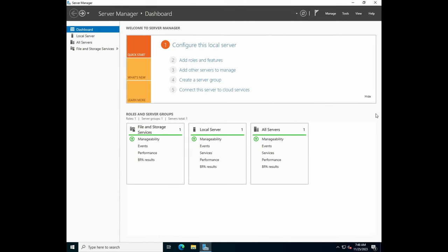The update finished. Let's get the data drives ready next. This computer has two SSD drives. I'm going to use data striping to configure them as one large disk with no redundancy, since this is just for a lab. In production, I would suggest using RAID 10 or another RAID level that can withstand a drive failure. If your drive's already formatted, you may need to remove the partition.